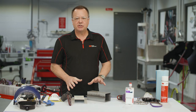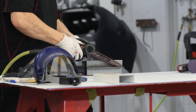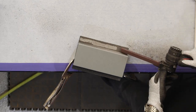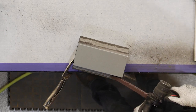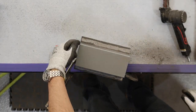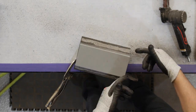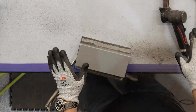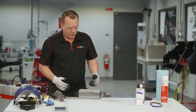The first thing I'm going to do is remove the seam sealer from the host panel. Typically in a repair it's covered with seam sealer where you can't identify where your welds are. I choose to use the file belt with a Scotch-Brite belt because this will really highlight the welds. You don't want to get overly aggressive — just take off enough material to identify exactly where those welds are. Some techs may choose a roll lock disc, but grinding with an abrasive will actually disguise the welds and make them more difficult to see.